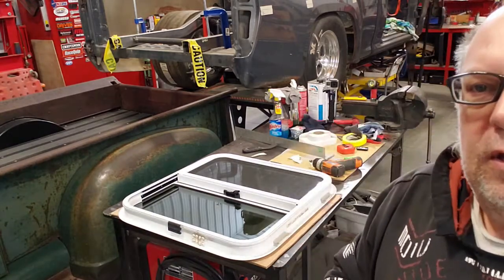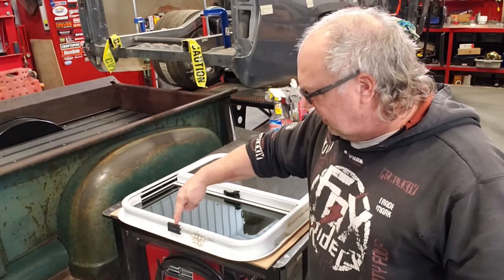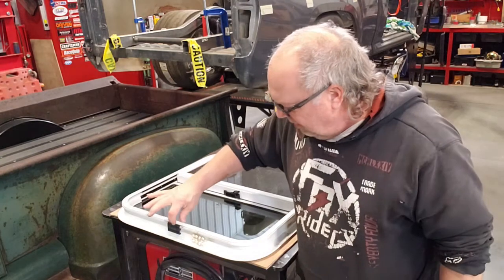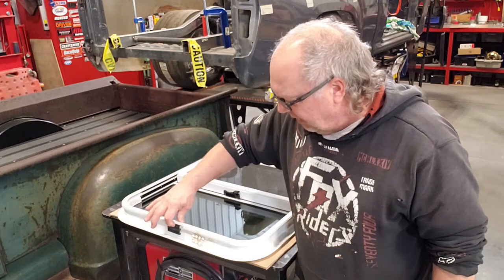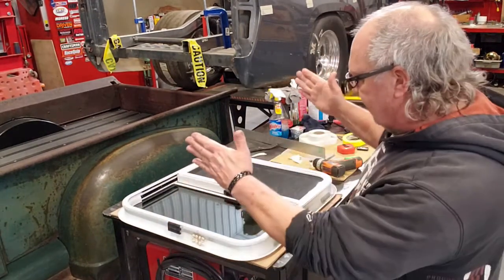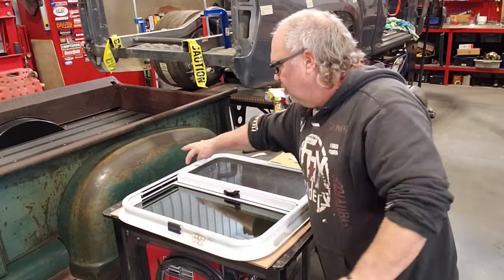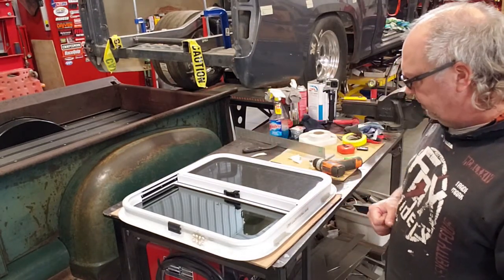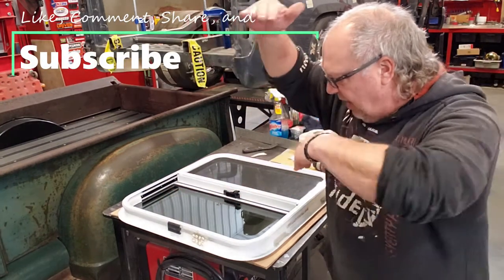And you can see it from right here. These little tabs here, these little plastic pieces, they keep the window tight in the 24-inch opening, but they allow a little bit of, I guess, support for the window frame. They keep it tight. These can compress a little bit and they keep it centered in the frame so it can't move around. So there's one on each side and there's 2 on the bottom because the weight of the window pushes down, right? And it's not on the top. So that's what keeps the window tight in the frame we have, I guess.